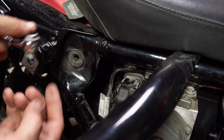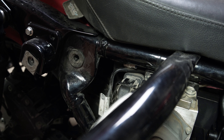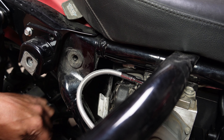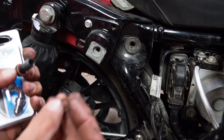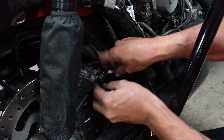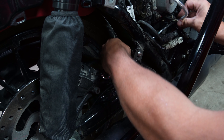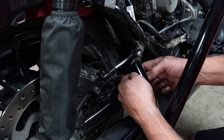Remember, the silver banjo goes on the ABS. We don't want to tighten this right now because we have to train this line and run it through here. So we're going to have to run this line about like this and hopefully get it to train itself. For the caliper, we got the black banjo — these both should be 10 millimeter banjos. I may have to flip this banjo over. We don't want this line getting close to rubbing the tire, and we need to get it in the holders so it stays in place, but not over far enough where it can ever end up getting cut again.